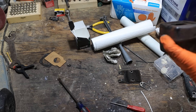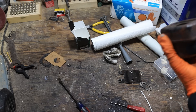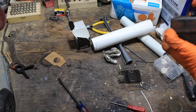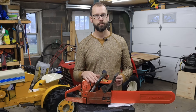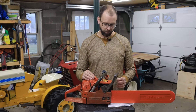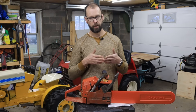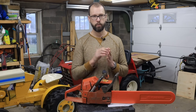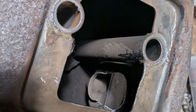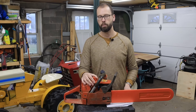A lot of people do what's called a muffler mod on these types of saws and I did that as well. One difference from the 257 to the 262 XP is the 262 has a little bit more of a free-flowing muffler - basically just a hollow box with no baffles in there. The port to atmosphere on the exhaust I about doubled the size of. It was a small circle hole; I made it a pretty big oval - maybe not quite as big as the exhaust port, but it's going to flow at least twice as much air.